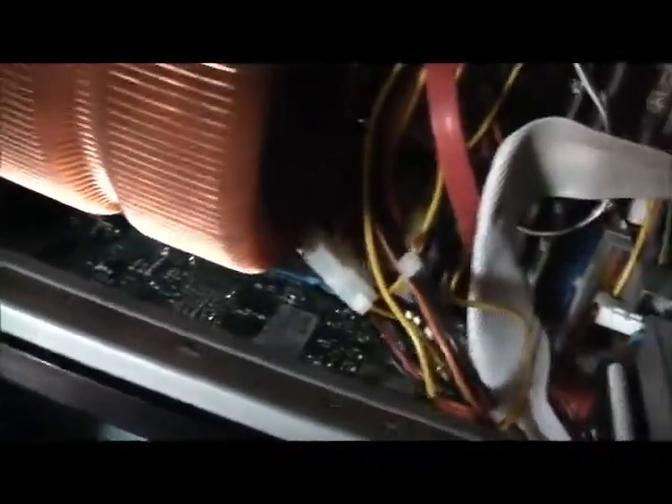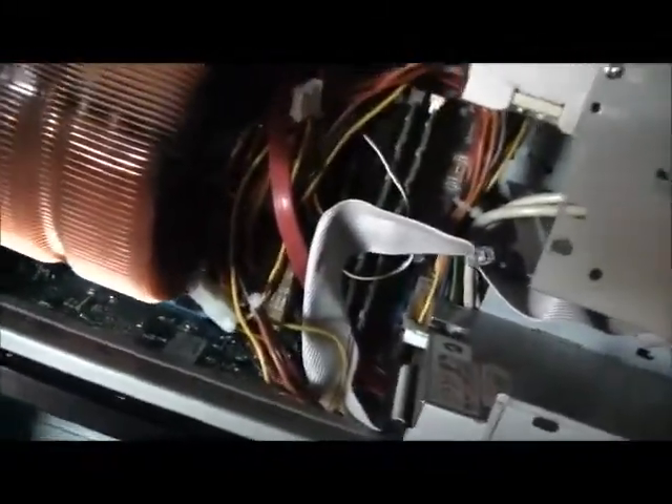I don't know if the 8800 GT is going to be supported on Windows 98, but I only want to find out. I'll just download the driver off NVIDIA GeForce and flash drive it over, if it works. Because I don't think the NVIDIA GeForce Experience supports 98 at all. I think the Pentium 4 should be good with 98, but I'm not sure. I only took all three sticks out and left one RAM stick in, the memory error was gone and it booted up. But if I can find some drivers that work backwards with Windows 98 to get the SATA drive to work, that'd be nice.